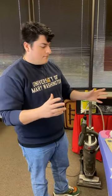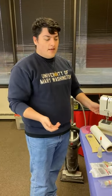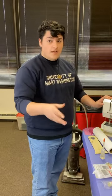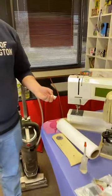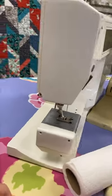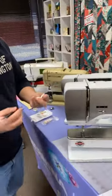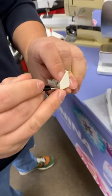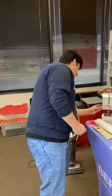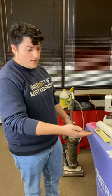That's the main exterior cleaning to keep your machine looking brand new. Another part of cleaning that I don't think happens as much is your thread cutters. On older and newer machines, the thread cutter can just pop out from the back of the machine. With a pair of tweezers, you can just find threads and pick them out. If you find your thread cutter isn't really cutting anymore, take it out and look for threads caught up in it — you might be surprised at how much thread you can find in there. This applies to both older and newer machines.